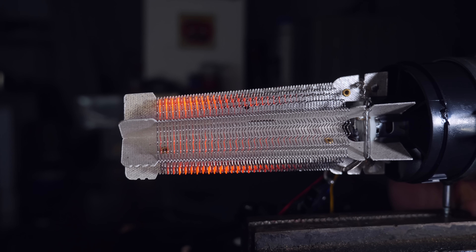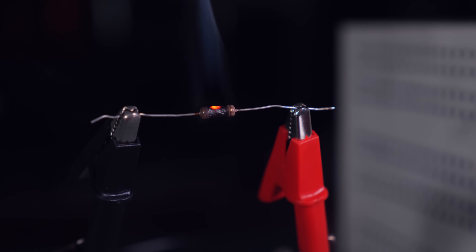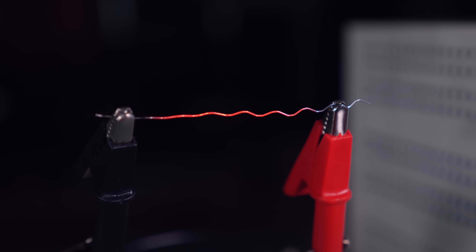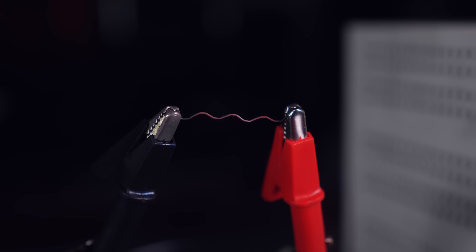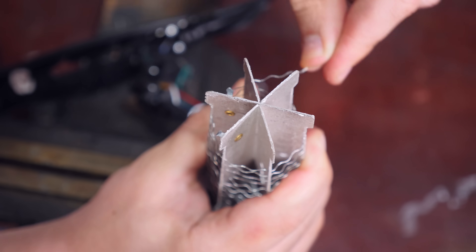Now, because all of this is very simple, either the air dryer from the video is running hotter, or the fan is running slower, or both. What makes the air hot in this model is a bunch of nichrome wire wrapped around a cross-like structure. Nichrome wire is like a resistor — when you pass a current through it, it gets hot. The more wire you have, the more current you need. But if you shorten the wire, you can get hotter with the same electrical power. So my best plan is to rewire the nichrome wire, make it shorter, and with a little bit of luck, it's going to get hotter.